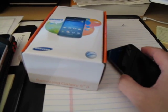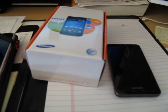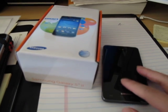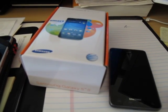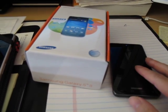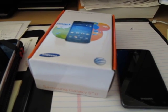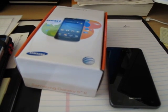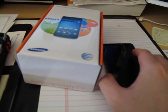When you start up the phone after flashing you might see a triangle — that's normal, it just means the phone has been rooted and is no longer on a stock ROM. If you want to get to 2.3.5, download the Odin self-extracting installer which contains the secure ROM. That will remove the yellow triangle and update the phone to stock 2.3.5. Since the update file is over 200MB, downloading it yourself is better than doing it OTA and exhausting your monthly data.